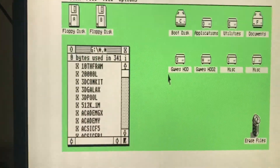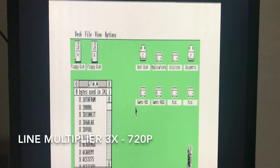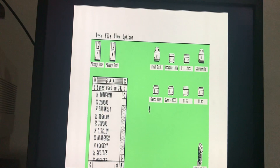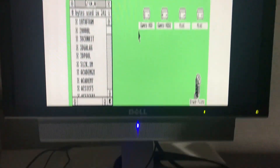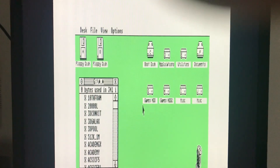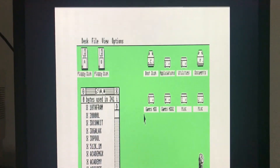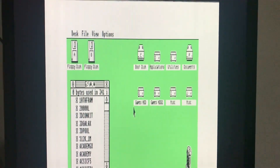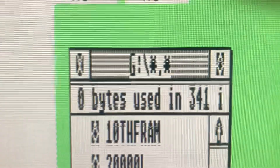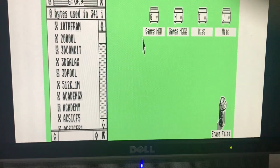This is in line double mode. What I'll do now is increase it to line triple mode. My VGA monitor of choice is the Dell 2007FP with the included soundbar — I get quite good sound and I like the picture. This particular model has various additional inputs such as S-Video and composite video. However, one thing it doesn't seem to like is the video changing modes with the OSSC, so as you can see there's some strange conversion going on with the text as well as some overscan at the bottom.